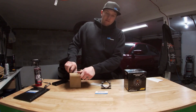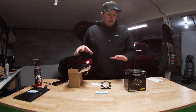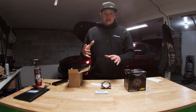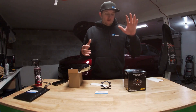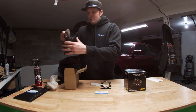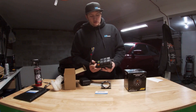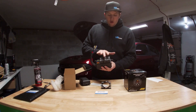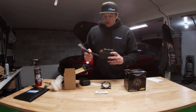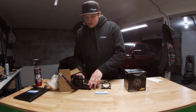When you wire one of these up, you're probably going to go off your cigarette lighter. I am going a different route, so I need to create pass-through wires with an additional harness. Rather than clutter up the wiring, I'll add a whole other harness with this — a six-relay box you can get on Amazon. I'll use four of these and have two more for lighting or something later. It's 12-gauge wiring if anybody's wondering.